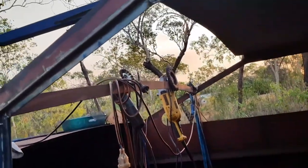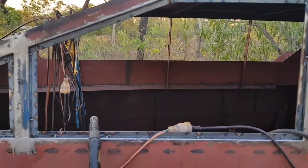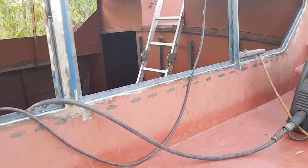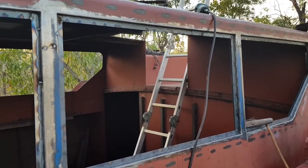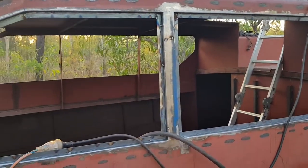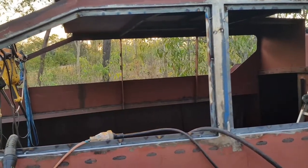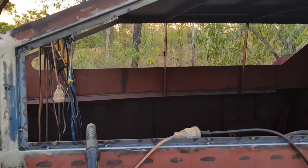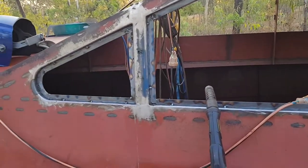There'll be three separate windows across the forward opening — it won't be quite as complicated as doing the sides because those windows are just in three flat sections, whereas these side windows were curved. Once you install the frames you have to decide whether you want the windows to curve and follow the same shape or whether you want them flat. I've chosen flat because with acrylic windows, once you flex them they tend to get a fisheye effect — they distort slightly — so having them flat is much nicer to look through.